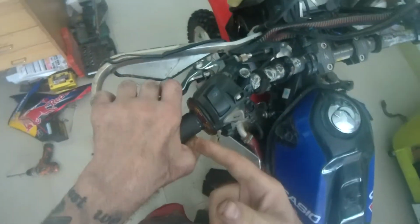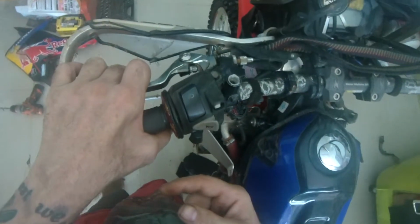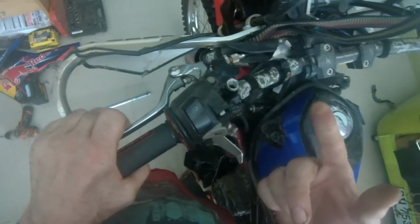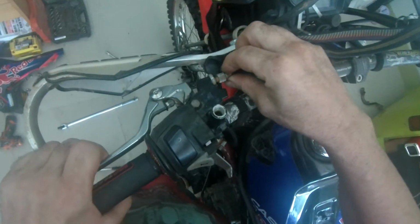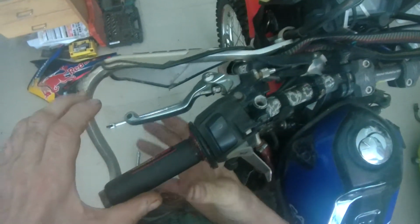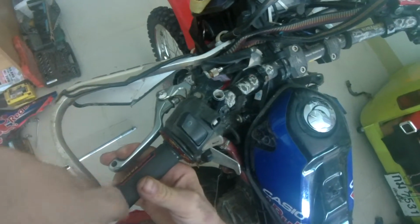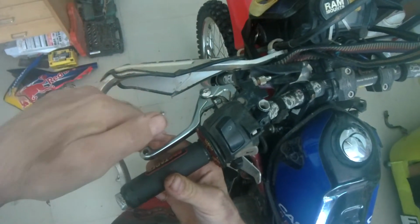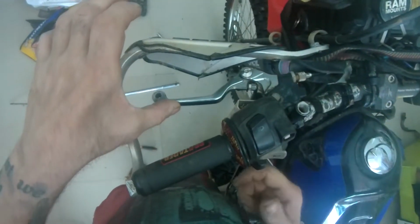Your clutch bite is where the clutch actually starts to drive the bike forward as you're letting the lever out. Now, if you've got no clutch bite, like Dan had the other day because they replaced his clutch, you need to make an adjustment. So, if your clutch has got the right free play, but when you pull it all the way in, the bike is still trying to move forwards, or you're having trouble trying to engage neutral, you need to get more throw on your lever.